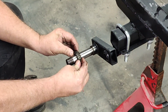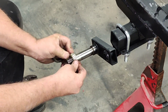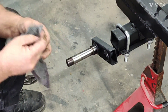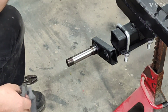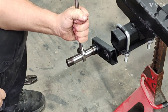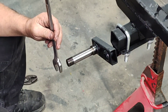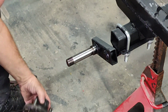The correct bearing for this shaft is already machined to have enough heat tolerance that it will not bind and will not be too loose. The right one doesn't move - brand new eBay bearing - all sold to fit the same axle. Don't do it. Now some of you are saying: how do I know what axle I have? Two thousand pound axles are one inch in diameter. You don't have a micrometer? Borrow somebody's one-inch wrench - it's tight on there, it doesn't move at all. An inch-and-a-sixteenth wrench will have play in it. Guess what the inside diameter of these Chinese bearings is - an inch and a sixteenth.